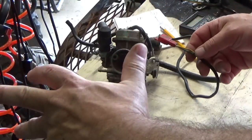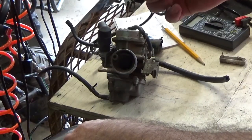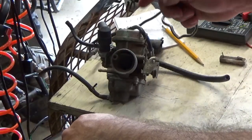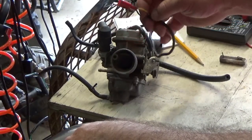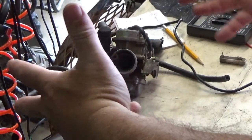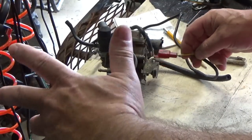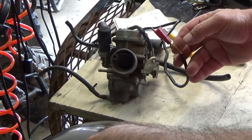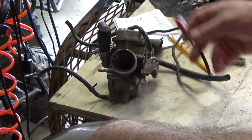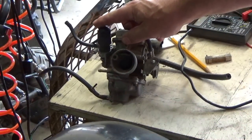What I would also do if it's not working is check the other side of this connector, which is the stator side. Do a quick check across here - given that this is like infinite resistance open, you would probably see around 25 to 30 volts AC. That just gives you a go/no-go. I would also test it with a 100-watt resistive light bulb: put it across there and see if you get a little glow. That's between the stator, going through the resistor to ground.